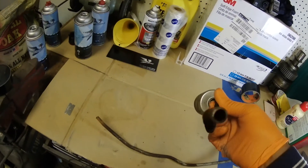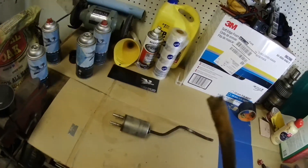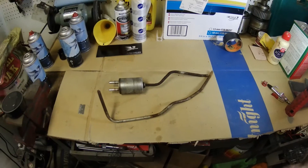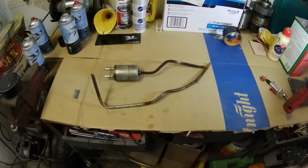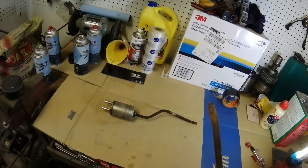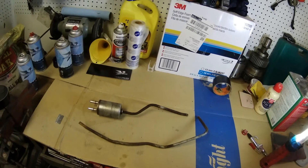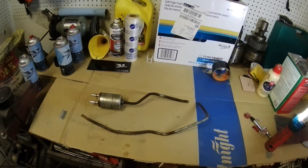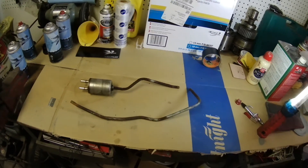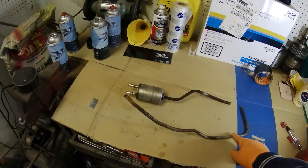But at least back in this area it's still solid — there's a lot of meat left on that. The insulation was put over the fuel lines to protect them from the heat from the exhaust pipe, but long term it ended the life expectancy of the fuel lines a little early. The brake lines are coated, so they have absolutely no damage whatsoever — GM was thinking when it came to that. But the fuel lines should have been coated also, and that probably would have been alleviated. But I guess as long as it makes it past the 36,000 mile warranty, who cares.